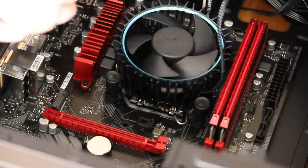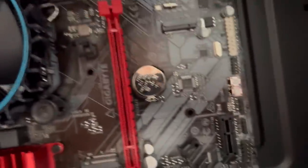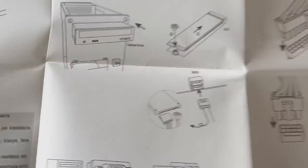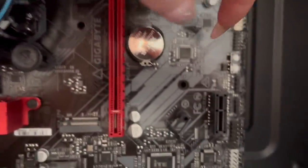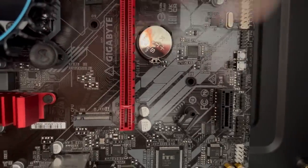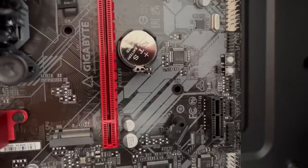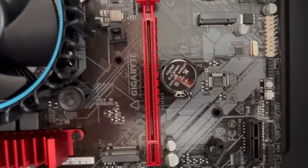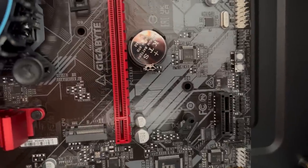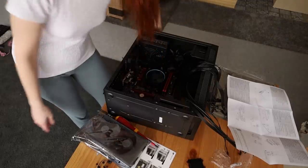The RAM is in. It took me a long time to figure out how to put the drive in, because in the manual there's a screw shown, but on mine there's no screw — there's a plastic clip. I finally figured out you have to pull the plastic piece out and then slide the drive in. Oh my God, that's horrible. It should be written in the guide — I spent so long trying to figure it out, and it's actually simple.